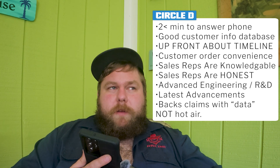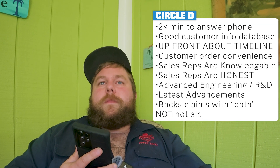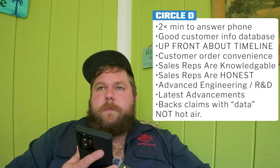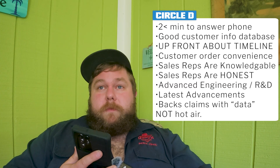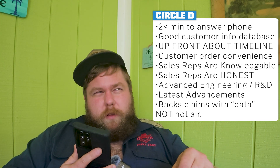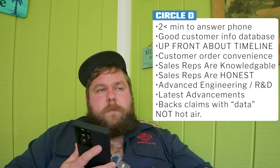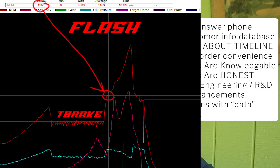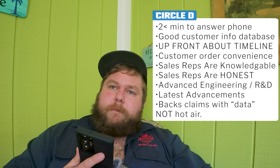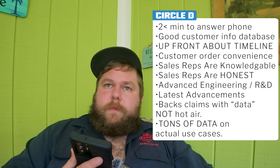Do you know the slip percentage I might be around at the top end? We can't know until we get hard data in the car, but we've seen data on these 252 millimeters with spragless stators as low as one to two percent slip — very efficient, assuming it's geared properly and turning the right RPM. I think we settled on like a 4,800 to 5,000 stall, so that's closer to your trans brake leave RPM, and your actual flash when you release the button should be closer to six thousand.